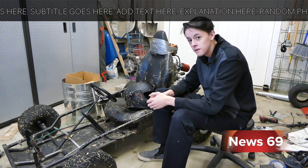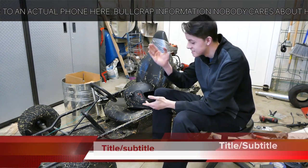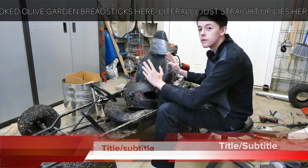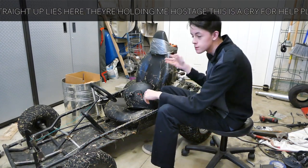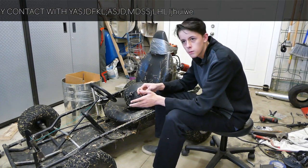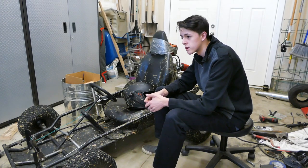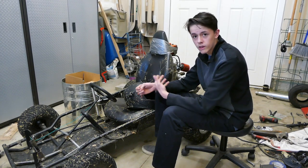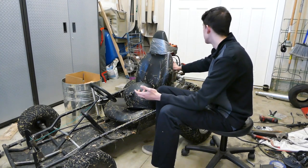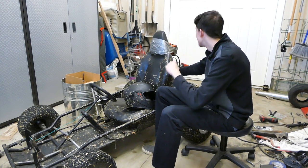This time, you can definitely hear in that clip that absolute pop. Oh, it's horrible. I don't know what's happening. I know the engine has no compression, there's absolutely no resistance when you push down on the thing. I pulled the spark plug out right after it happened, and the piston's still moving up and down. I don't see any valve damage, so I don't think it dropped a valve. So it didn't throw a rod or anything. I think it's up in the head, but I don't know what it is, and I'm a little bit concerned. I don't know if I want to take it apart.